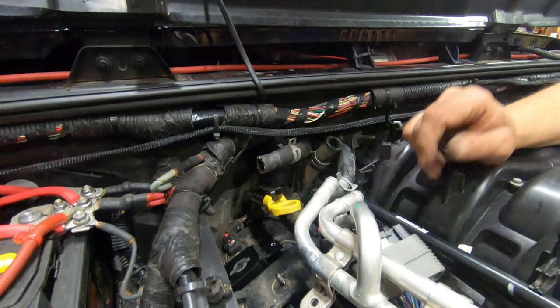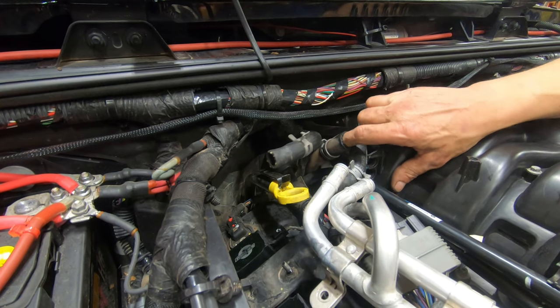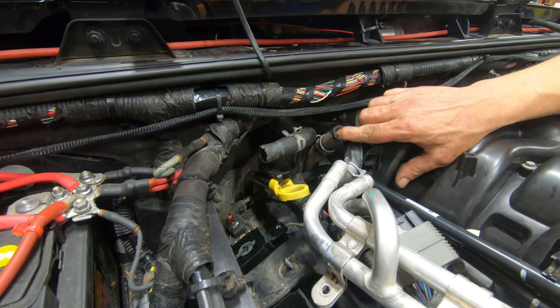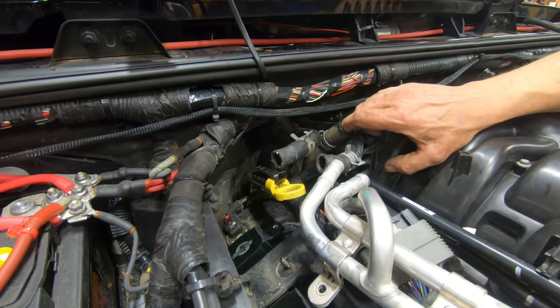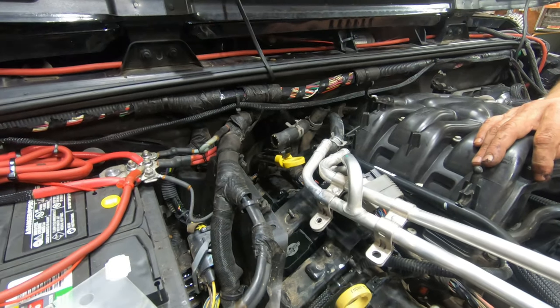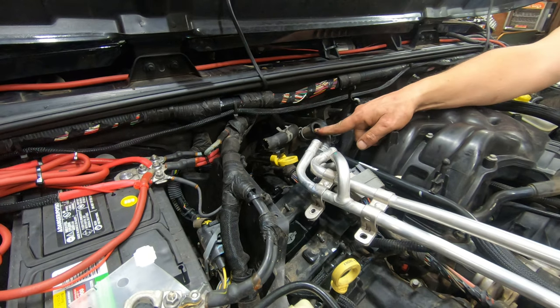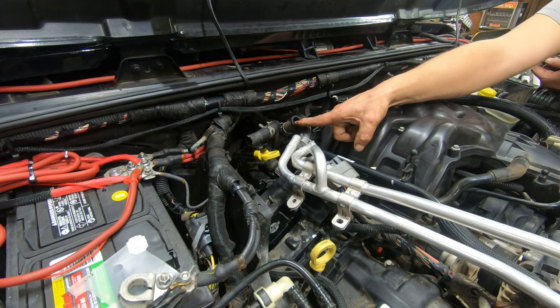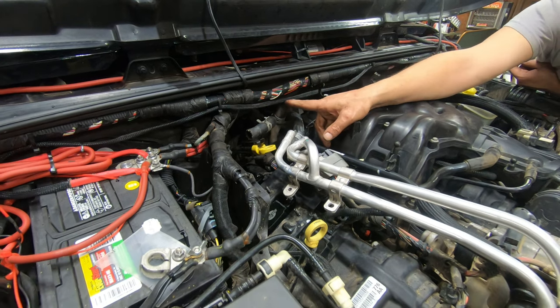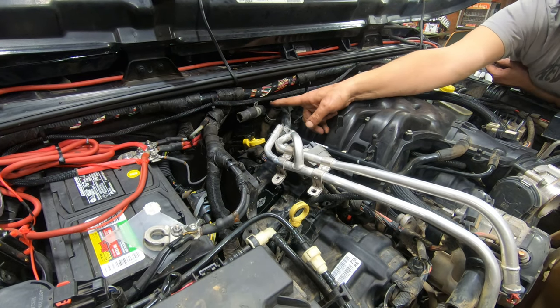This hose? Yeah. So this is water, and it goes to your oil cooler. I would recommend that if you're going to do the oil cooler, obviously do this hose too, because it connects directly to your oil cooler, and you don't want to ever have to go back down in there again. Once you do this, it's kind of like do everything that you can on the way out. It is a chore. All hoses need replaced eventually, and if you haven't kept your radiator system clean and it's muddy or whatever, I'd definitely replace that hose as you go.